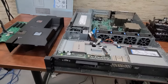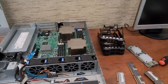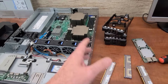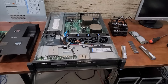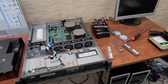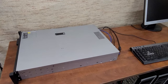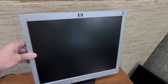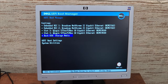For this build I'm just going to use my old PowerEdge R510. It's pretty old but it'll support four drives. I'm going to have 16 gigs of RAM, a 10 gig NIC, and that should suffice for OpenMediaVault. I've got all the hardware installed — just put in a 120 gig SSD for the boot drive. We've got our OpenMediaVault flash drive, so I think we're ready to rock and roll.